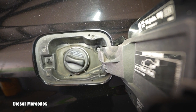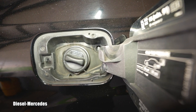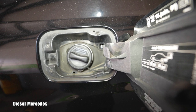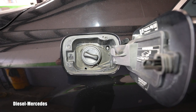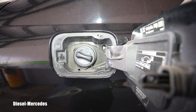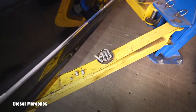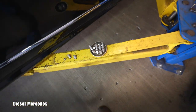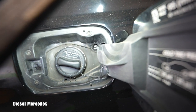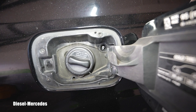In the tools near the spare tire there should be a special tool for the emergency release. You insert it and turn clockwise three times to release the electronic parking brake. In my case, everything except the short lug nuts needed for the spare tire is missing from the tool kit, so I'm proceeding without it.